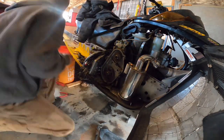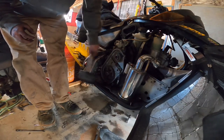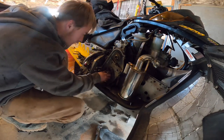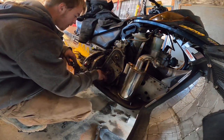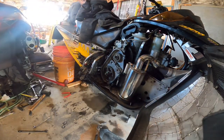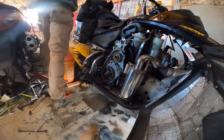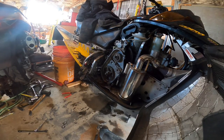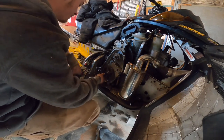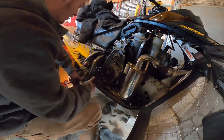I'm putting the collar on now and looking for that bolt. I punched it in with a rubber mallet just a little bit — I don't suggest that, because you could move the shaft. I was stupid but I did it anyway. Then I put the bolt on with the lock washer. Order a new chain if your sled is above 4,000 miles — that's what I did. To tighten this bolt you have to put the chain back on, then put your brake on, because if you don't you'll just spin it.